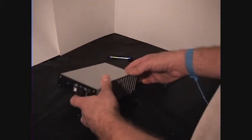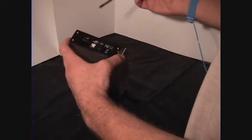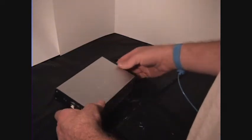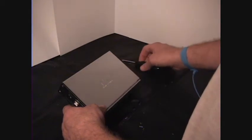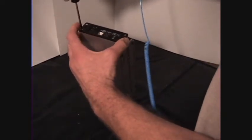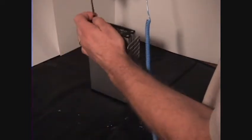Assuming that you've tried all that and you're still not getting anywhere, we're going to take the hard drive out of its case. Now this is a pretty simple one. There's four screws here and two screws here on the bottom. Sometimes you have to peel off a label to expose the screws. Other times there's like a plastic plate. We'll take these screws out. Keep in mind that if your drive is still under warranty, opening it up will void it.